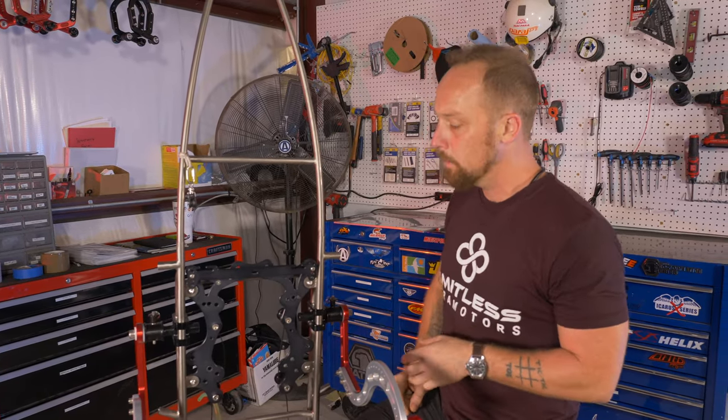So this part popped out. Okay, clamps are loose. Did you hear that little snap? That was it popping out between the tubes. I'm gonna set this one to 13 millimeters, so we will have a total of 7 millimeter offset. Because remember, we set the other side up a total of 2 centimeters or 20 millimeters. So we'll go 13 on this side, total of 7 offset. Didn't think you'd be doing math today, did you? Okay, there's that.